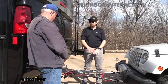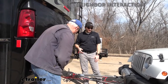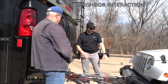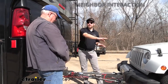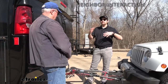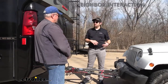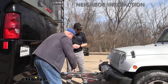The concept of flat towing is pretty simple — we're keeping it flat and towing it, as the name suggests. We're eliminating any of that chucking you might see from dollies. Because we're keeping it level, these arms lock themselves in, and the car follows right behind your motorhome. It tracks really nice, makes it a lot easier to drive, especially pulling into recreational areas. It's not going to be as much of a pain as a trailer.